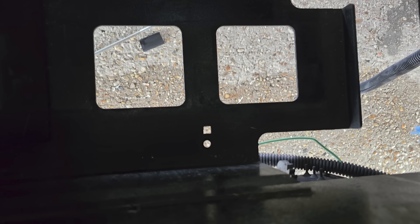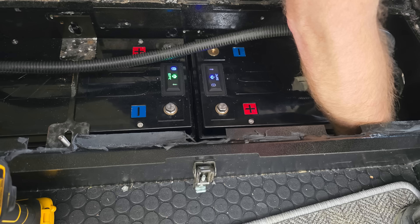The 315EX battery is a little wider than the standard Group 31 — or the supposed Group 31 — that the Winnebago uses. Because of that we need a hole that's a little further out. There's plenty of room; in this case we drilled a new hole on each side. We first put the batteries in to mark where the hole needs to be, and then we're going to use something like a 12.5 to 13-inch bolt to secure it. We'll mount it from the bottom and put a retaining nut in — you can use all-thread for this.